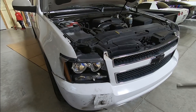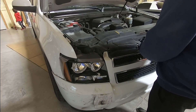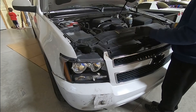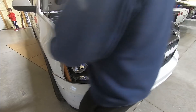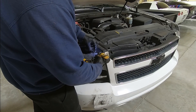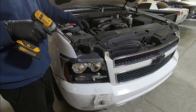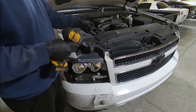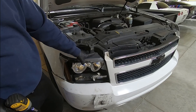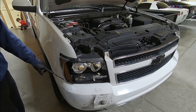Let's grab a 10 millimeter and get these bolts out of the top. I'm going to use my quarter inch impact just because it makes life way easier. Those are all the ones that actually go to the grill — you can see it's loose. We're going to have to take this all back off again once we actually get the bumper. Now these are both broken up top, but normally you have two here. For those who may not have followed me when I put the headlights in, there's supposed to be a third bolt that comes in from the side, and these light housings have been taken out before. When you don't know what you're doing, people tend to break those off because they just start pulling. I'm going to see if I can hunt one down while I've got this apart.